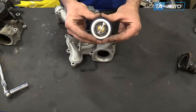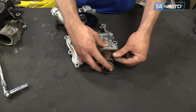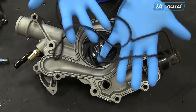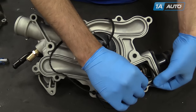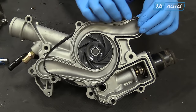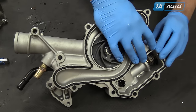Make sure the gasket on your thermostat is still in good condition if you're not replacing it. Reinstall your thermostat housing onto your new water pump. Install your preformed rubber gasket into the water pump, making sure that you line up all the corners and joints appropriately and that the gasket is properly seated into the groove. Otherwise you can get excess gasket hanging out — it can become pinched or folded and not allow it to seal up properly. Once you have it seated, give it one more quick check to make sure it's in all the way before we install it into the car.